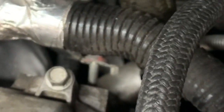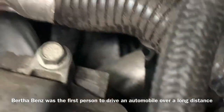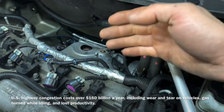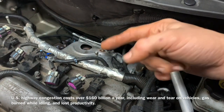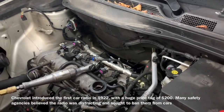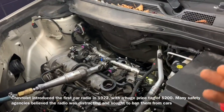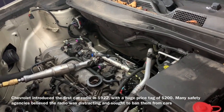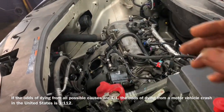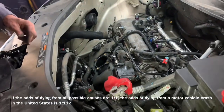You can see that bolt hanging down right there — that's the one we were talking about. Frank removes the O2 sensor so he can get the exhaust cover off because the catalytic converter bolts to the downpipe of the exhaust. He's going to remove the exhaust manifold from the rear of the engine prior to pulling the engine — actually, no. Frank tells me that if this vehicle was all-wheel drive, he would have to remove the exhaust manifold to get to some of the bolts at the back of the engine, but because it's only front-wheel drive, he doesn't have to do that. Now we're also going to remove the cover over the high-pressure fuel pump.